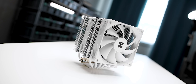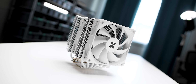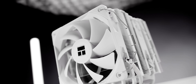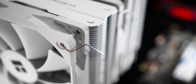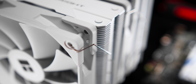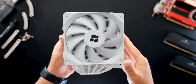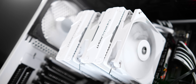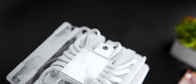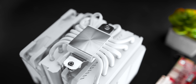So what we have here is a budget-priced cooler that's supposed to run head to head against some of the best around. You'd expect some corners to be cut somewhere, but I sure as hell can't find where that happened, because the white version is just stunning to look at. And the build quality is top-notch too. Overall, it's pretty compact for a dual tower heatsink that uses 120 millimeter fans — basically a millimeter higher than the Fuma 2 while being a lot more compact in length and overall width. Let's start with the base, which uses a pure copper core that's nickel plated and polished to an almost mirror-like finish.